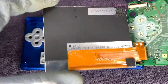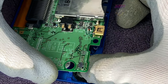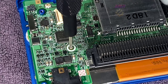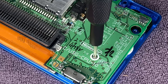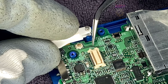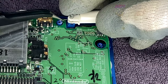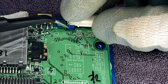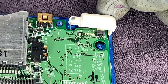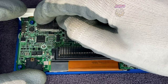I'm going to guide the screen into place first, followed by the PCB, and then while having that lifted, insert the speaker and push it all down. With that all pushed down, we can put in the two Phillips screws to hold the board into place. Once those are in, we can reattach the trigger buttons, making sure to put the spring into place and checking that it functions fine before moving on. Some patience is definitely needed for these springs — they don't always go in first time. Don't forget the Wi-Fi board has to be connected, otherwise the DS won't boot up.